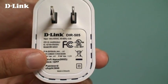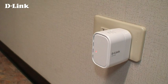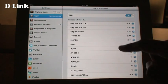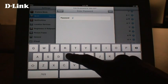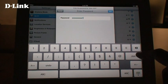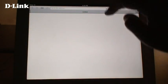Make sure you write down the default Wi-Fi name and password printed on the back. Plug in the DIR505 and wait about 1 minute for the LED to turn green. Use a PC or mobile device and connect to the default wireless network you wrote down earlier. Our default network was D-Link 1DFF. Enter the default password for the device, then open the web browser and enter D-LinkRouter into the address bar.